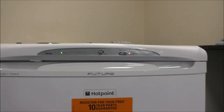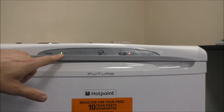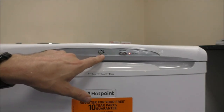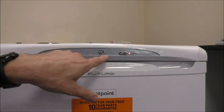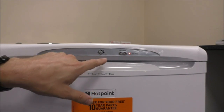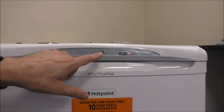What I've done is I've actually plugged it in now. The indicators on the front - first of all you've got the power, so there's clearly power to it because the green light is on here. In the middle here we've got the temperature setting, so you'd normally just use a coin to change that. It goes between 1 and 5 and clearly it says number 5 is colder. What you tend to find is for an average kitchen, you'd normally start it on say number 3 and go from there.